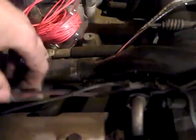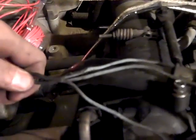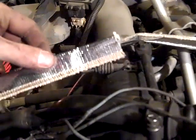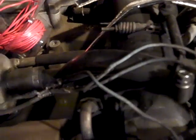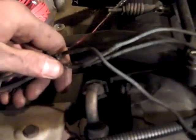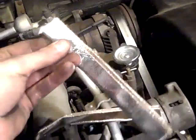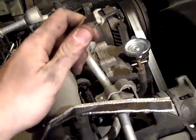I'm just going to cut up these wires, replace the frayed parts, and I bought this — it's a heat shield. After I cut the wires, I'm going to slide that on first to protect the wires from burning up again. Another idea for you guys if this is something you've run into with your 6.5 diesel — it's just a thermo heat shield to keep it from melting.